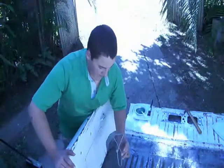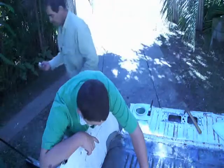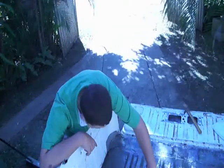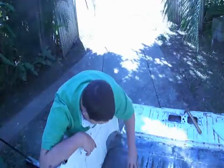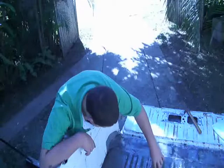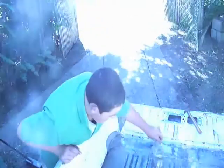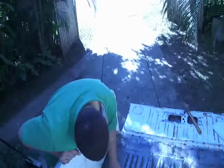Picked up this $10 fiberglass roller, and it does a good job of just blending it in. Gets all the air bubbles out that we've missed with the brushes. Because we can't just paint over it with the brushes, we have to dab it in. Otherwise all the fibres will displace. And this is the last patch. So after we sand and spray it with some spray putty, it should look pretty good.